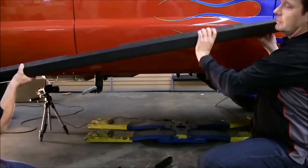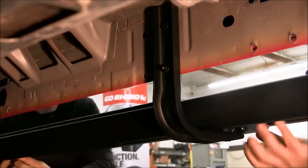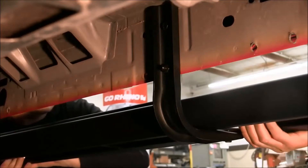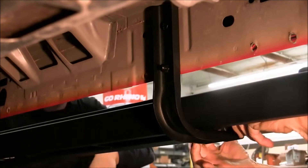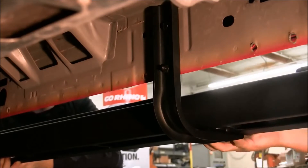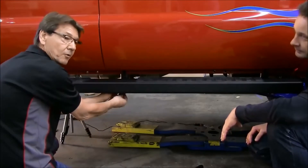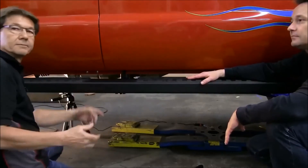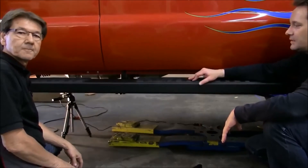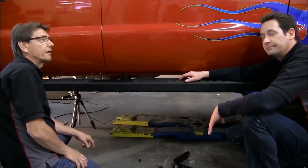Here's the 6 inch OE Extreme 2. Just slide it around there — there we go. Then pivot those U brackets around, adjust the bar front to back and side to side how you like it. Install the remaining bolt into the U bracket, tighten them up, and you're ready to go. On a 6 inch OE Extreme 2, typical install time would be about 30 to 45 minutes.